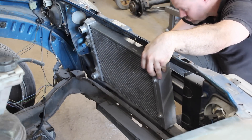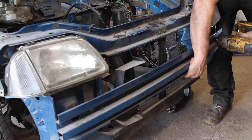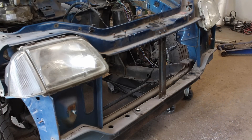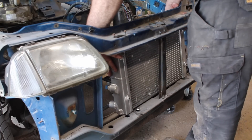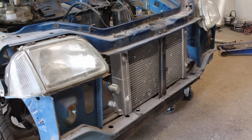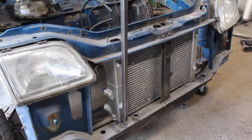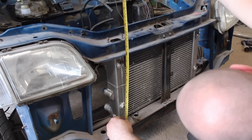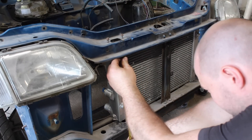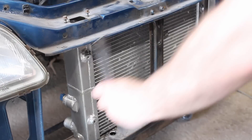The rad seems like it will be a good fit. Removing the bumper bar gives me better access — I may not refit it. I had anticipated fitting the radiator in the grommets for the stock Metro rad, but it's sitting quite nicely a little further back and a plan presents itself to mount it using two lengths of angle. Two 12 inch lengths are cut and fettled into a tight fit between the core support and the lower frame.